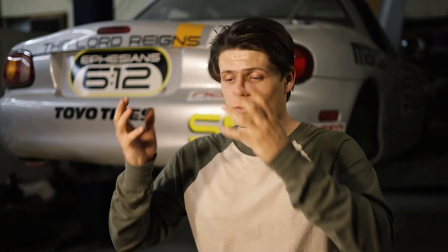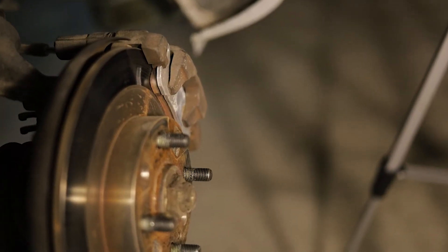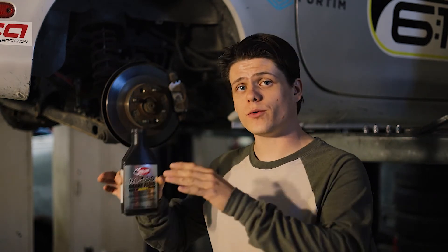We're putting new videos out every other Monday right now, so please like this video and get subscribed so you don't miss out. These brake pads were changed so recently and look so chunky that I'm gonna save myself a little time by not having to loosen up anything under here. Once the systems are prim and proper, we'll go ahead and ensure we evenly distribute the new fluid by doing our best to bleed a quarter of this bottle through each brake bleeder. That way all the old fluid that was in each line is pushed out and replaced with the fresh fluid from the source.